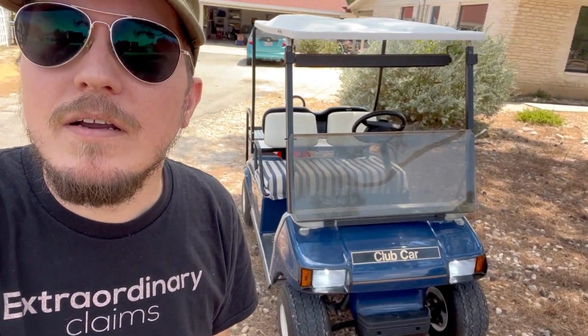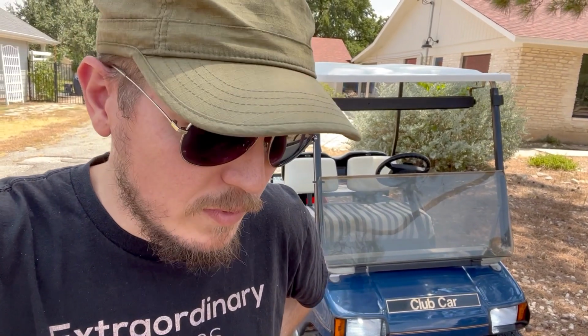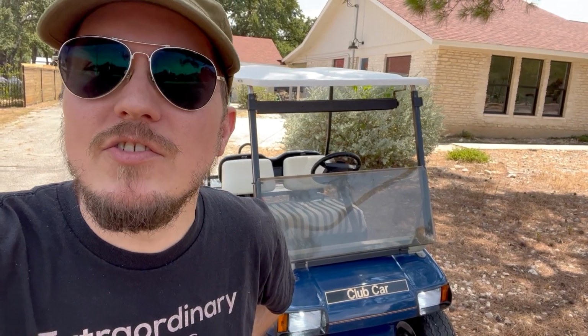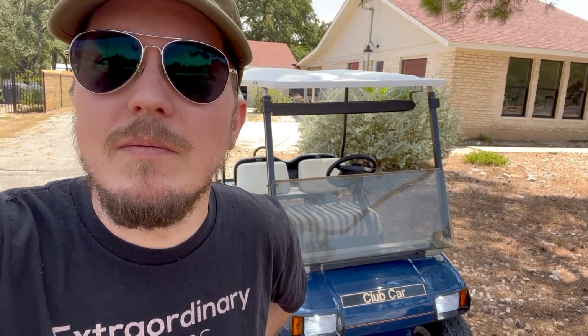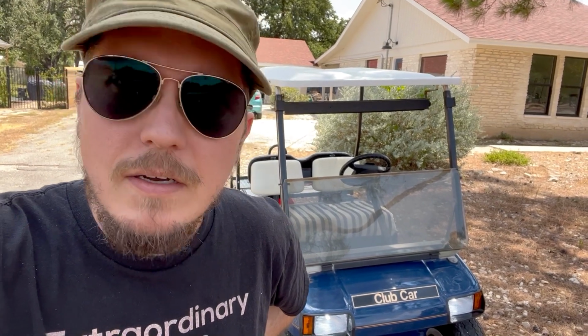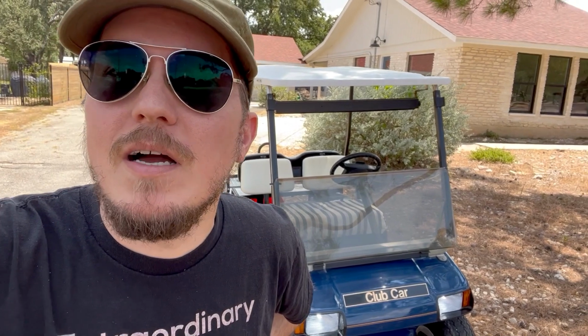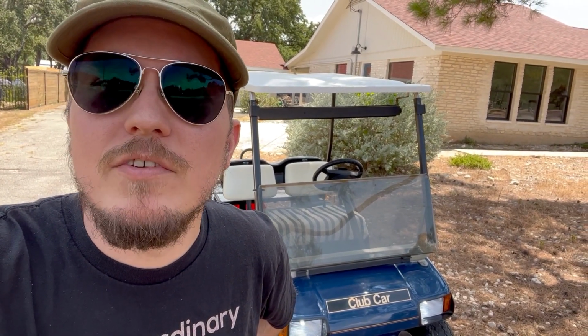First I'm going to show you my club car here. I'm going to explain to you why it is that I went with the BigBattery over the Epoch very shortly. The reason is current. I measured the current. I've got some big hills in my neighborhood, and I measured the current going up the biggest hill, and it's a big old hill, and it takes like 30 seconds to get up, and it draws 150 amps continuously up this hill.